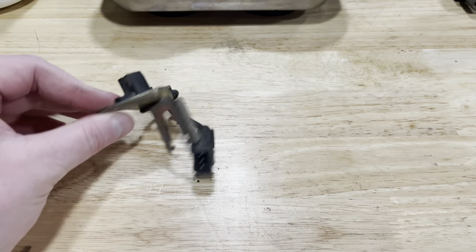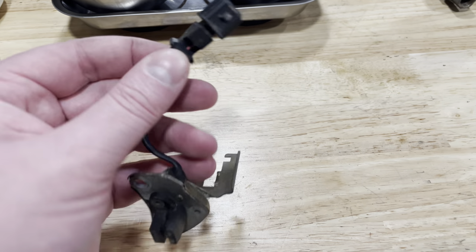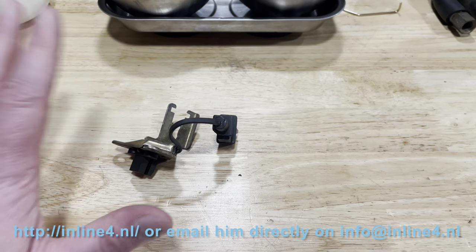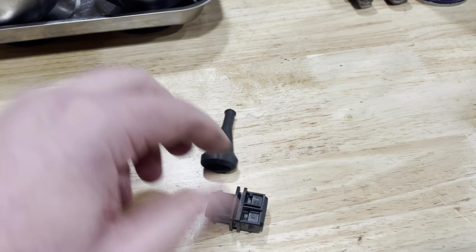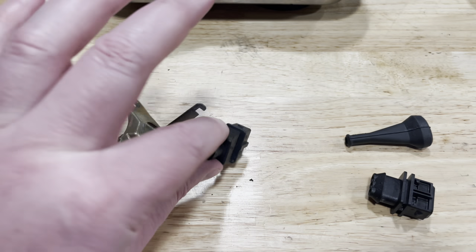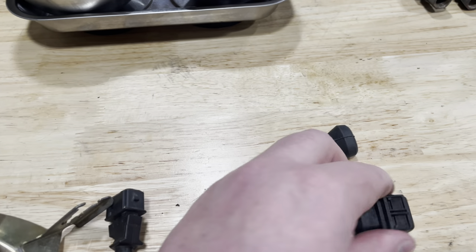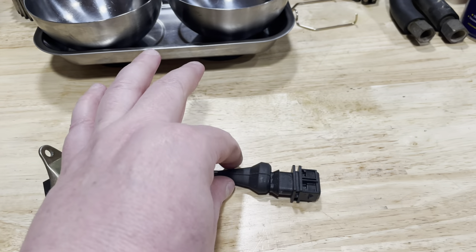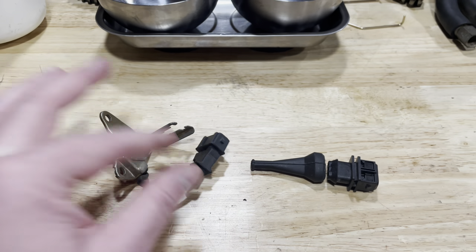In the previous video I showed you that this Hall Effect sender's plug has disintegrated. This is a common problem on Porsche 968s and 944s. I was thinking I'd have to buy a new one, which is about €100 from Bosch. Luckily my friend Patrick, where I get all of my second-hand 968 parts from, told me I do not have to replace this. I can fix it - he had a solution which was this little plug and rubber boot. All I have to do is break the old plug into pieces to get the pins out, repin them into this new plug, and I'm done. This is all of a couple of euros. I'll put a link in the description so you can find these plugs and hopefully save you guys a lot of money.